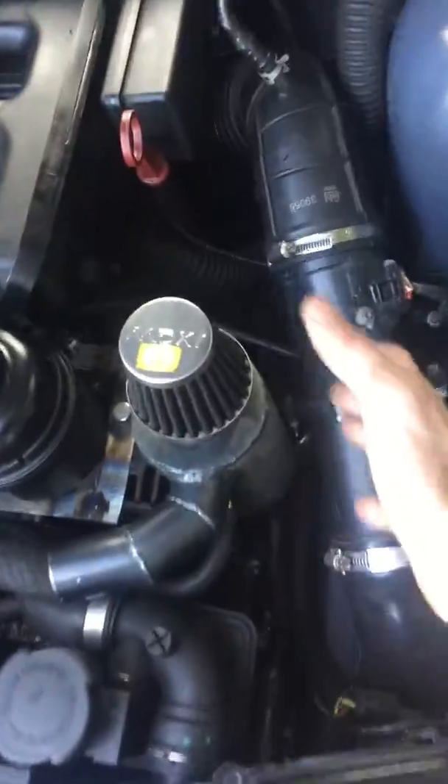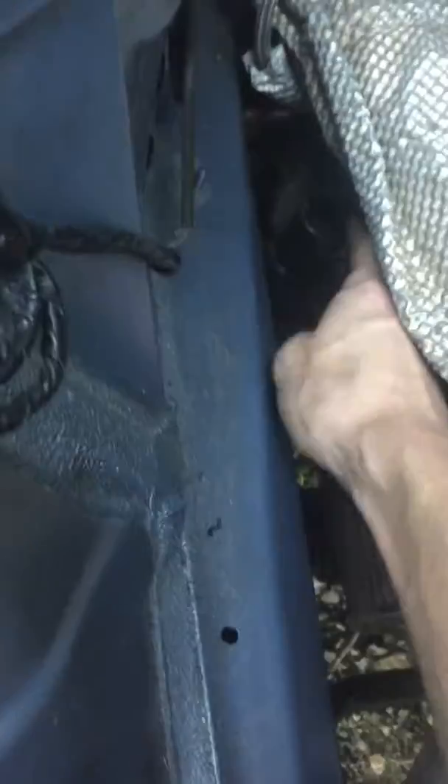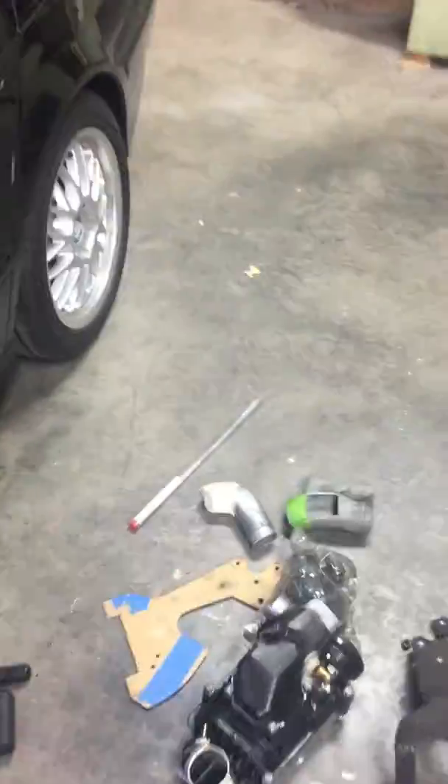Here's the car it was on — the supercharger sat about right here at an angle. I used this intercooler here — it's a single-side unit with intake and output. Right now I've got an eBay GT30 with a custom engine mount that kind of makes the arch in there. The oil feed runs to a drip tank, comes up this tube into this scavenge pump down here, and then goes back to the engine.